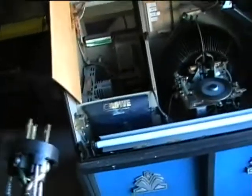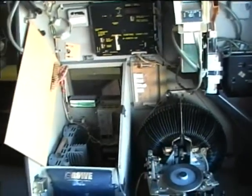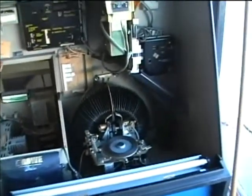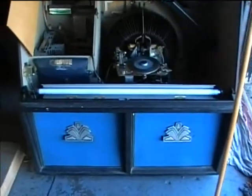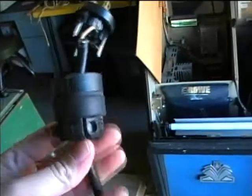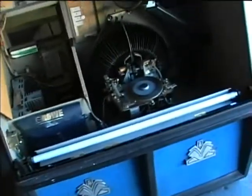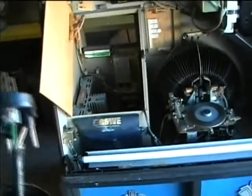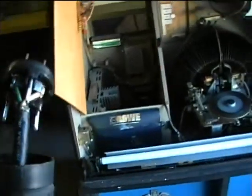I only saw this on one other thing — a Hammond Organ L100 series — where someone had spliced a power cord and hooked the green and black power leads up to supply power to the L100. This is just a warning everybody should heed: if you're ever working on anything that has a homemade or home-wired plug on it, make sure you take that plug off and check it — even extension cords — so you don't end up getting shocked by somebody else's wiring mistake.